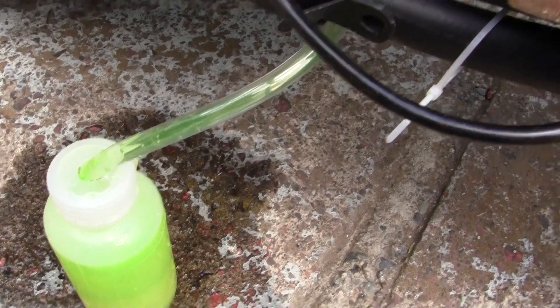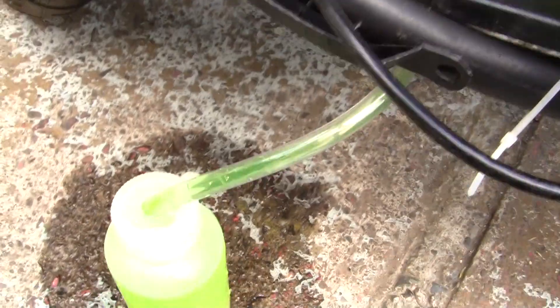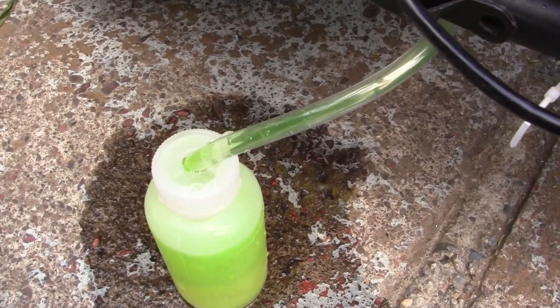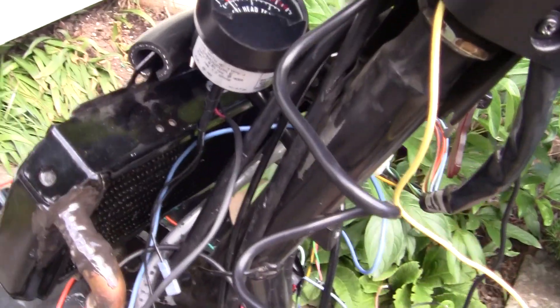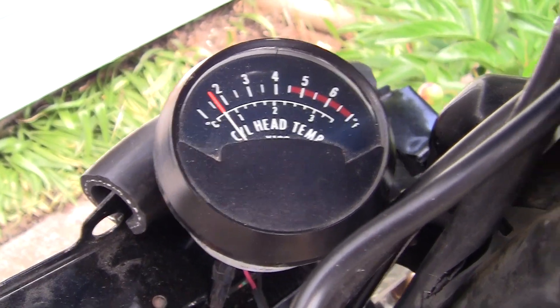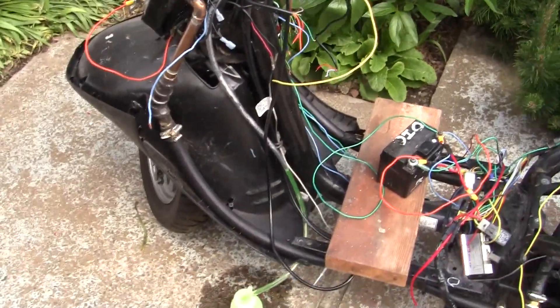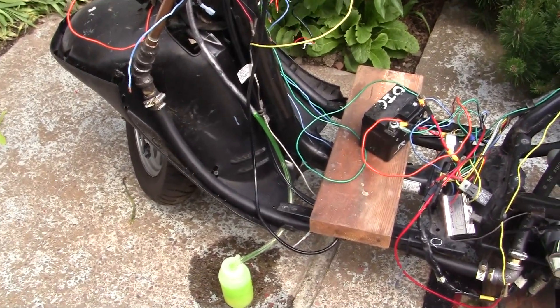The vacuum in the system wants to refill the radiator with this fluid. I'll probably have to put a lot more in here because this bottle shouldn't be this low and this line should not be that long. But you can see that the cylinder head temp is slowly going down. This process will happen four, five, six times while you ride the bike. All it is is getting the air out — it blows the air out.